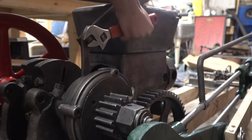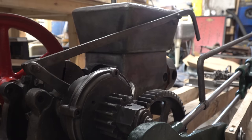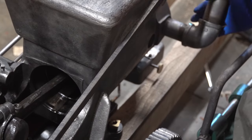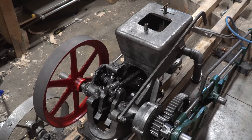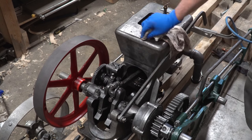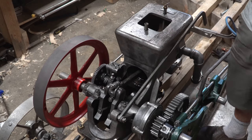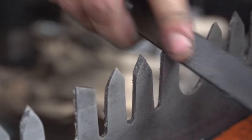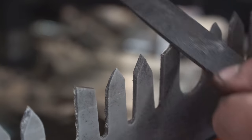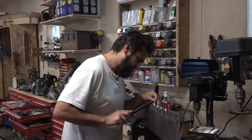Finally we're attaching the clutch arm, so you can engage the clutch when you're holding on to the handle. Cranking the muffler downwards this time and not directly in my face. I'm giving everything a coat of boiled linseed oil just to protect it from rust and to stop any dirt getting in places it doesn't need to.